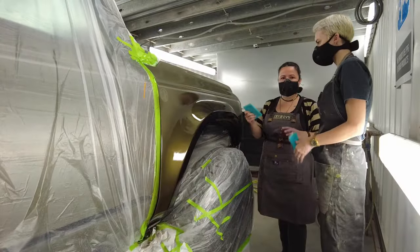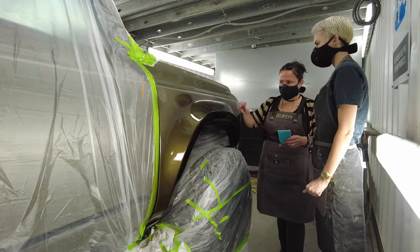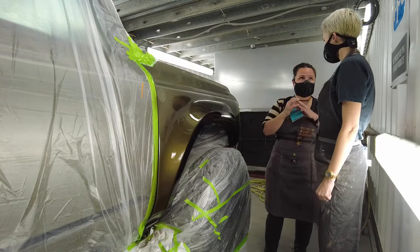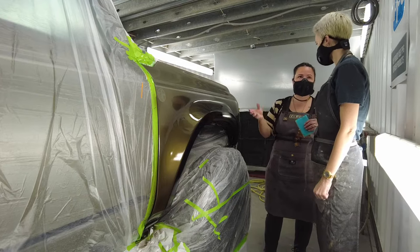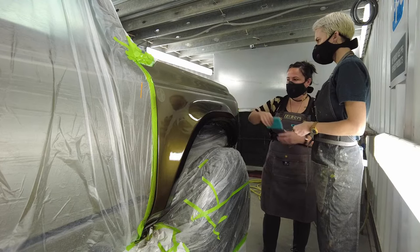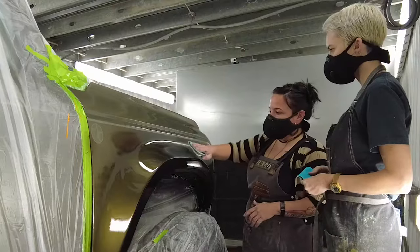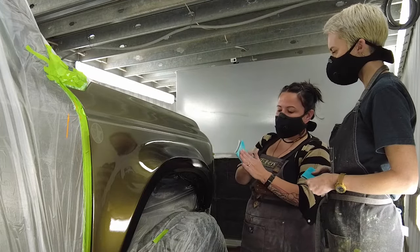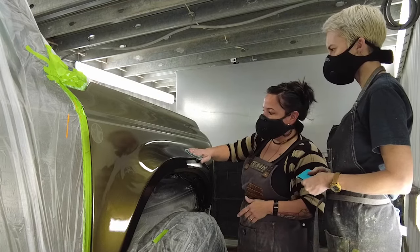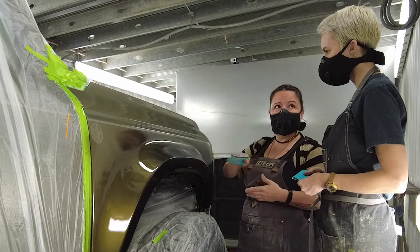Now we go from making this shiny to making it dull. We're basically making a surface so that the paint and the clear can attach to — that's why we're sanding it down. We're using the 600, so most of what you're going to see is you want to get almost all of it so it's not shiny anymore. Typically you will get some formed lines in there, but we're doing it lighter, going sideways so that the surface is flat and not your fingers directionally.